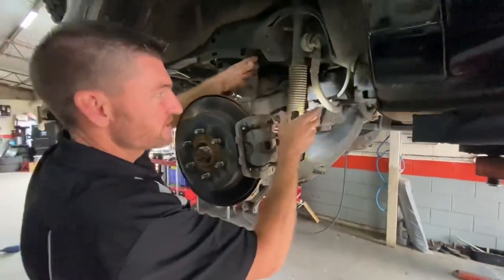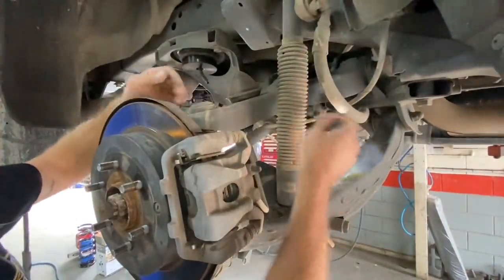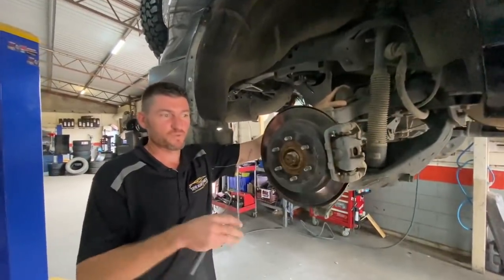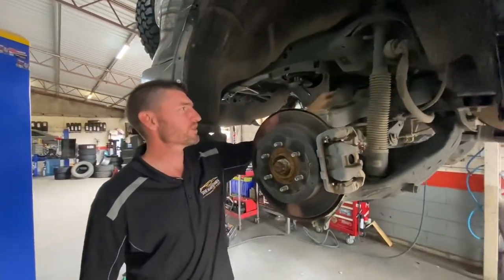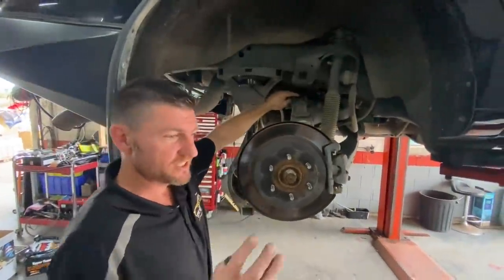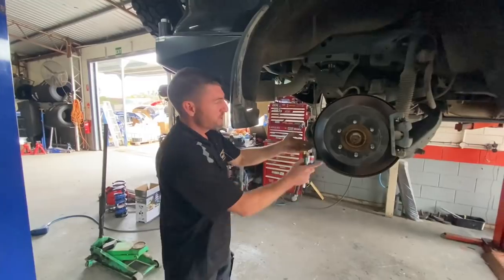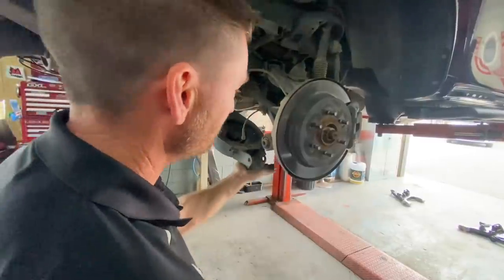The HBMC line and everything will just move out of the way nicely. The little 13mm nuts that hold the flexi line for the brake caliper - get that off as it's part of the arm so you can get it out successfully. Once you've done the arm, we'll show some pictures in this video of the positions where we put the grease. Over-grease the bushes so you don't get that horrible squeak. Also grease the K-frame where it slides in so you don't get rubbing and squeaking.